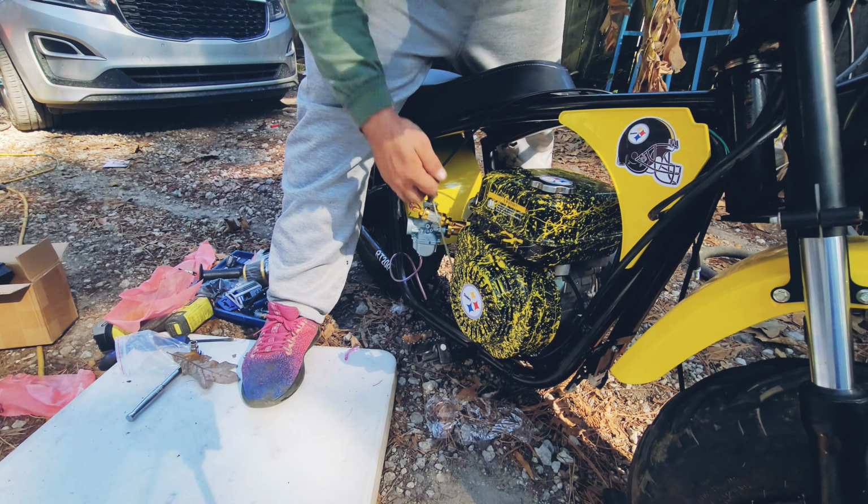Jet might be too small. So that might be something I have to play with. Oh, maybe the kill switch is off? Yeah. I don't think I unplugged anything. Oh, derp. I forgot to hook up the spark plug. Hey man, I'm not even getting a sputter. It's like, come on, I should at least sputter. Alright, first pull, ready?